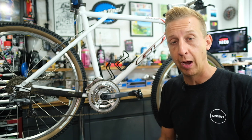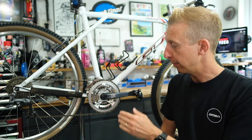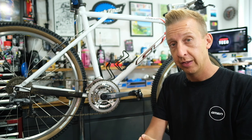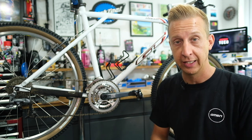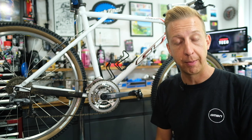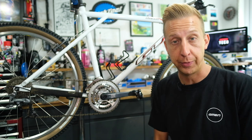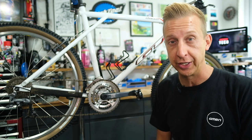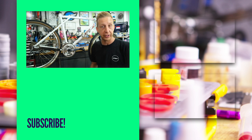There's not a lot that goes on with a front derailleur — there's nothing to be scared of. Once it's adjusted, you rarely need to do anything to it. Unlike the rear derailleur, where the cable has to be super smooth, because it's only working on three or sometimes two chain rings, how dirty the cable is rarely affects the performance of the front derailleur. That's about all you need to know — just a few adjustments, and now you understand what those adjustment points do. If you've got suggestions for other videos, let us know in the comments. I'm going to make one on setting up V-brakes, since they're still commonly used on mountain bikes and we haven't really done that on GMBN Tech. Thank you for hanging around and thank you for your support.